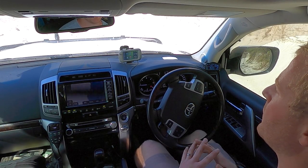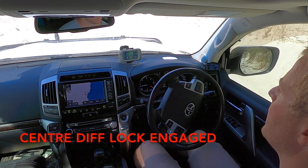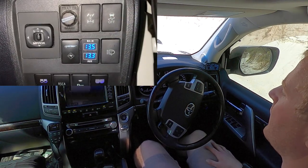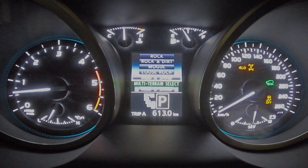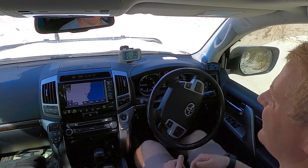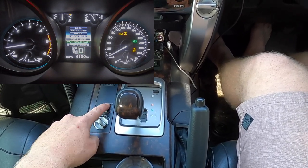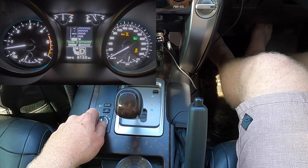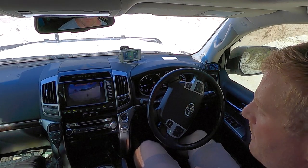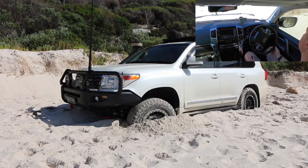To get the car bogged we had traction control completely off, which means open diffs — the car just sends power to the wheel with least resistance. To turn it back on and enable crawl control, press the traction control button by the driver's right knee. On the Sahara model this takes you to multi-terrain select. Keep in mind this is only available in low range four-wheel drive. Stick the car in drive, press the on/off switch next to the gear shifter to turn crawl control on, then use the rotary knob to select speed. We're going to choose a medium-to-high speed — about four out of five — and just let the car do its own thing.